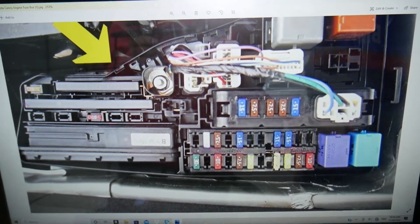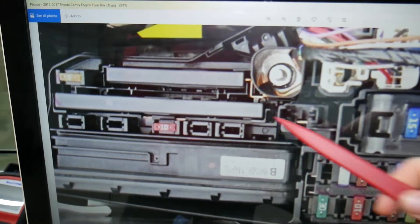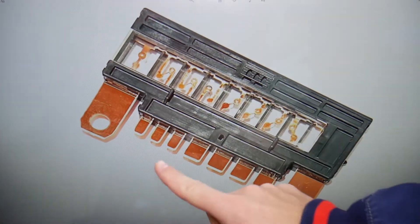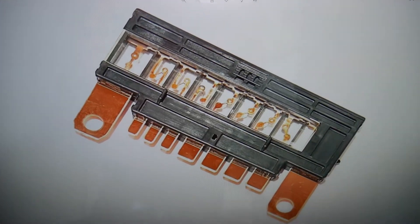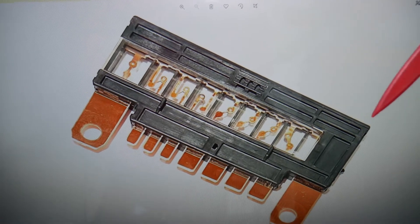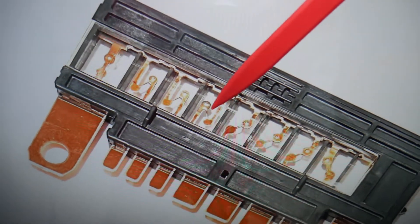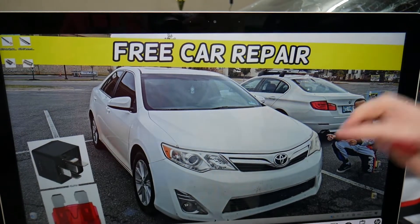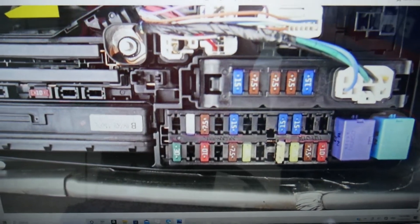One of them is a multi-link fuse that consists of multiple fuses integrated into one. Here's the top view and the side view. If you come from this side and count along, fuse number eight is the one for the headlights right here. The bad news is that if one of them burns, you have to replace the whole fuse link. We'll put a link in the description where you can get one at a good price with quick shipping.